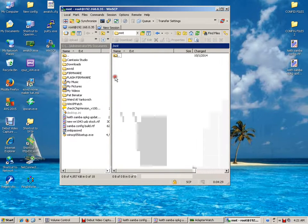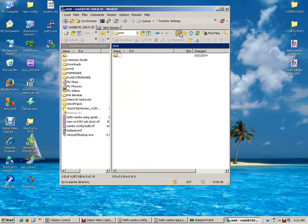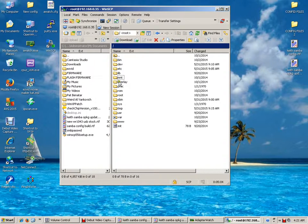Okay. Now there's going to be 2 more folders in there, but they're not quite in there yet. I'm going to have to reboot it again. Okay, I'm going to give that full access. But the other 2, there's going to be SDA1 and SDB1, and when they pop up in there, you can right click them and you can restrict the access on them. But I don't want to do that. It's going to be my home networking, and I just want to click onto it and go with it.